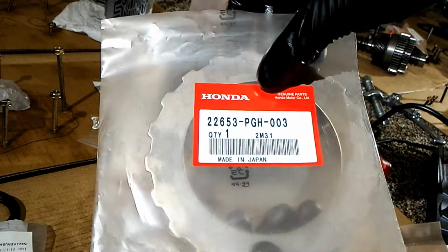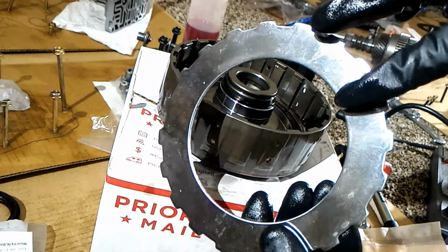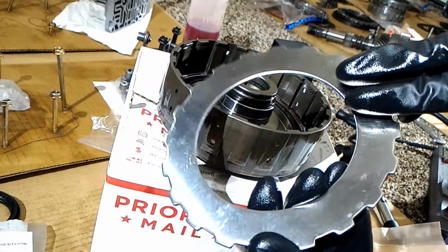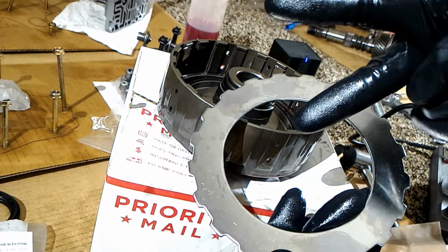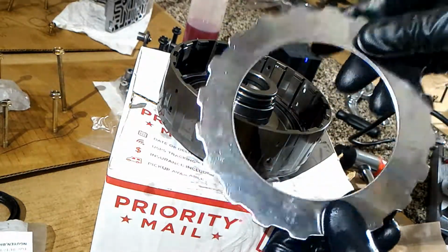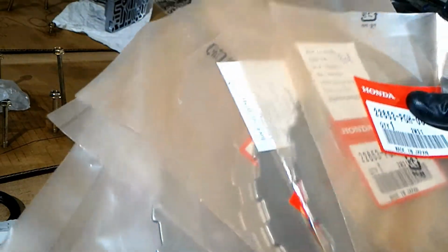Right, here's the part number for the third clutch plates, also known as steels. And you can see this one's really shiny, so I know that this is the updated version. The inferior old version had number 400 sanding and it was too rough, and this I'm assuming is number 600 sanding and then 2 more steps of 600 cork. So looks like this one did get fixed. And so for third clutch, I've got 1, 2, 3, 4, 5. There's 5 plates here.